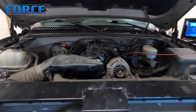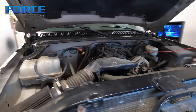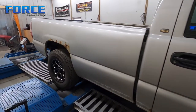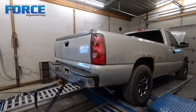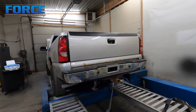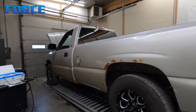So yeah, this is a 6.2. It's got a BTR Stage 4 camshaft in it. Some 706 cylinder heads that have been cut a bit to add some compression - I believe it's 12.7 to 1, something like that. Still on 93 octane. Talking about possibly putting it on E85, depending on how stuff looks today, if we think that'll be worth the change. Being that it's a Silver Lake toy - Silver Lake is our local sand dune play area - sand dune stuff, climbing hills, you're often under heavy load and low airflow, so some cooling advantages from E85 would be the larger benefit over a horsepower change.